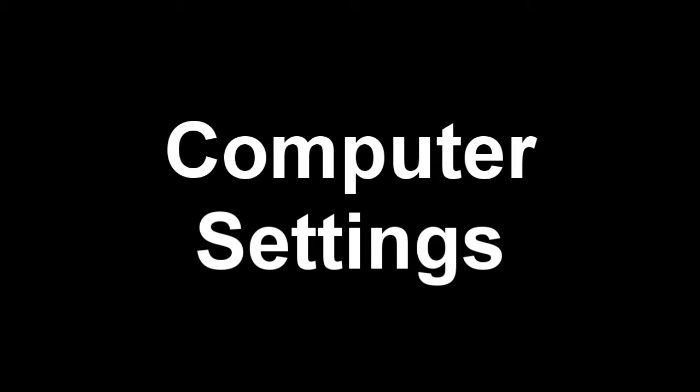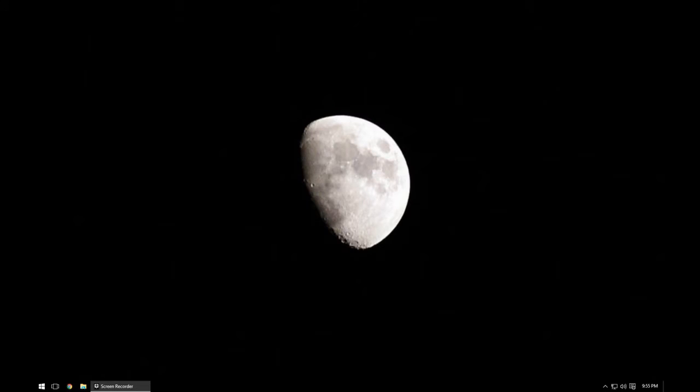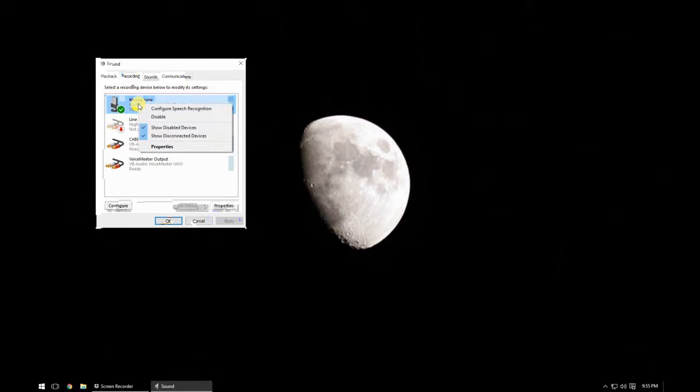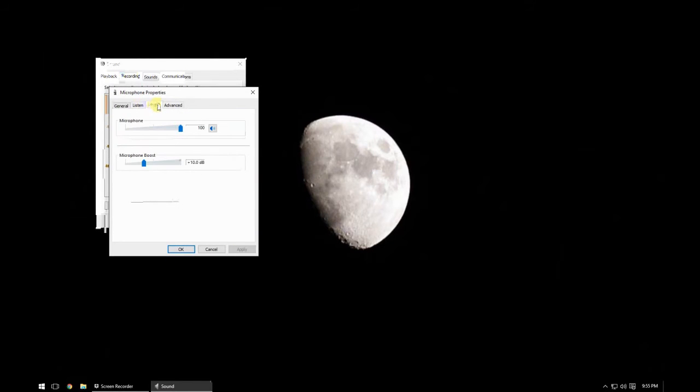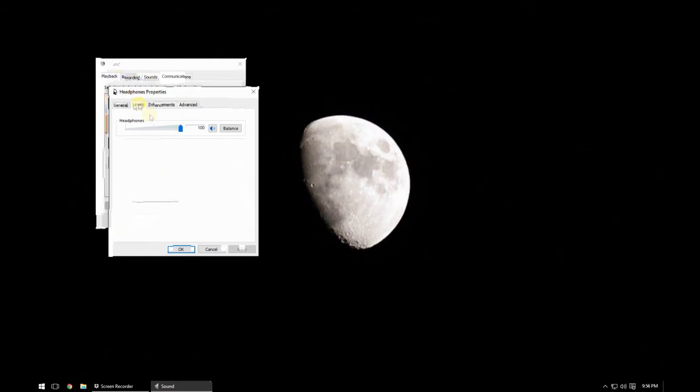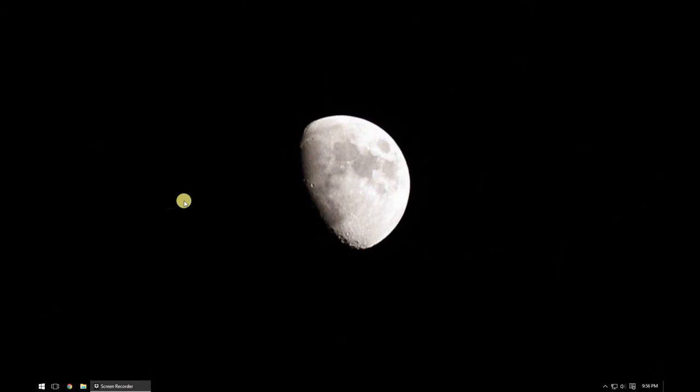Before downloading any software, it's a good idea to make sure your computer is set up correctly. The only settings we're concerned about today are sound settings, so right click on the speaker icon in the task bar and select Sounds. You'll want to make sure that you have no sounds selected for the system sounds tab and hit Apply. Go to your recording tab and ensure that your recording device is set to 100% but with no boost. Then go to playback and select the port your EasyDigi is attached to and go to Properties. I usually like to set my level to 30. You may need to experiment with different volumes to drive the device correctly.